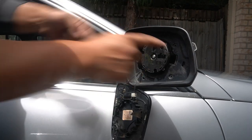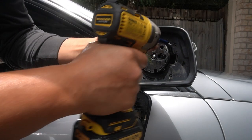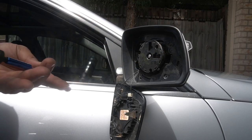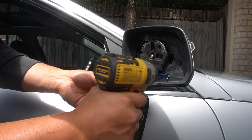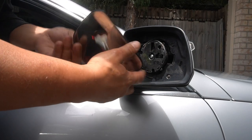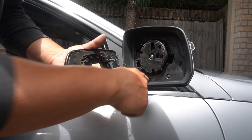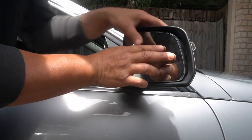Make sure your silver tabs are still clipped in as well for the side cover. Now we'll grab our three T10 torx screws and reinstall them — one, two, three. There you go. Now it's just a matter of clipping this back on and we are done. When you clip this back on, see these two silver prongs — they have to sit on the outside. Make sure they sit on the outside and then simply push it back on and it will clip on like so.